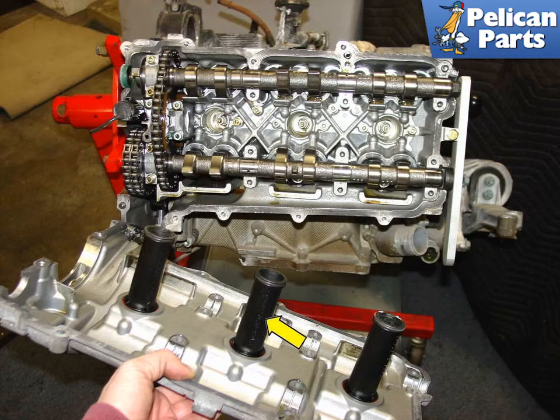It's okay if it pushes out by a few millimeters. Various sources note that the camshaft can snap if there's enough force placed on it from the valve springs, so make sure you don't move it significantly out of the bore. The yellow arrow points to the spark plug tubes found on early engines. Now would be a good time to replace them and the O-rings — found on 2005 and later 997 cars — that seal them to the cylinder head and camshaft cover.